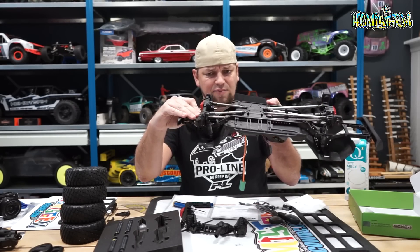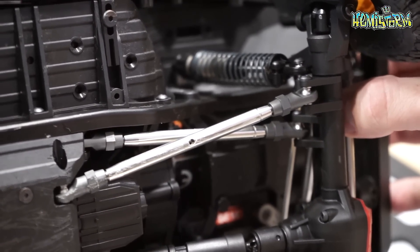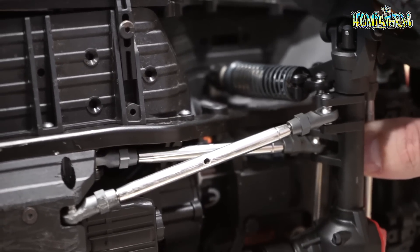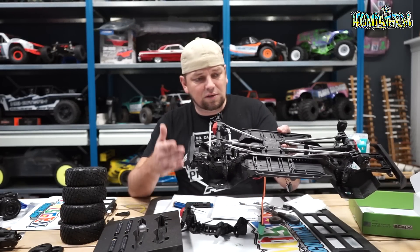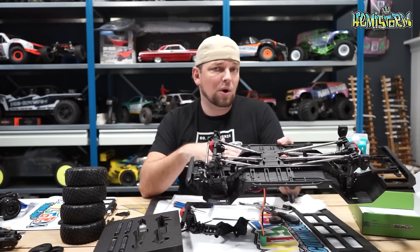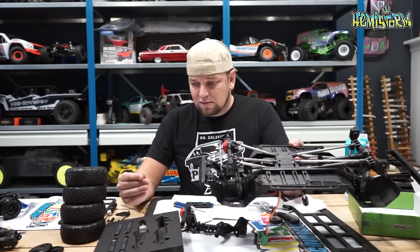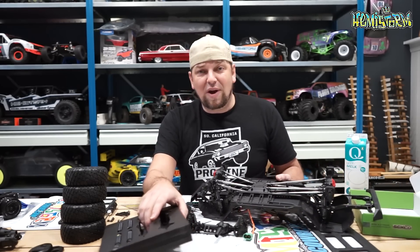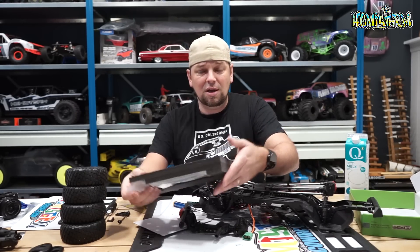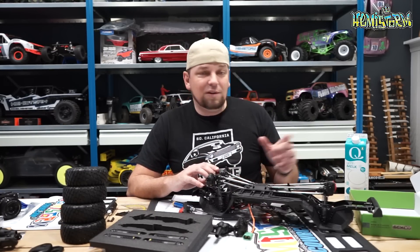I don't see the need to replace the shocks — they fully cycle. You could mount the shock tops in different locations since there are five different mounting positions, but I'll just run these 90mm shocks to get the truck sitting a bit lower and more realistically, and keep the 100mm shocks as spares. One tip: if you want to prank somebody, give them that piece of foam from the box — the bottom is sticky and will really mess up your hands.